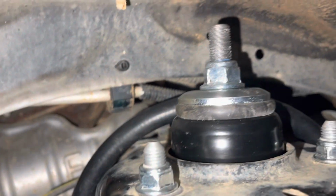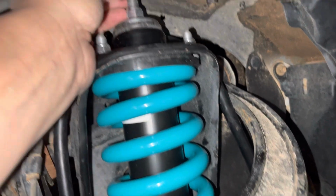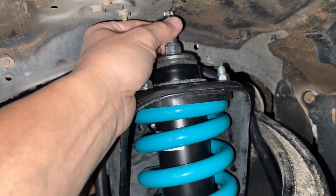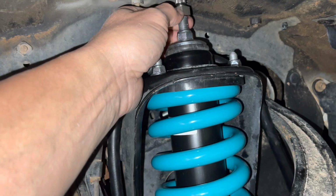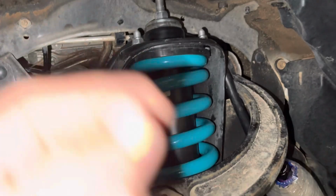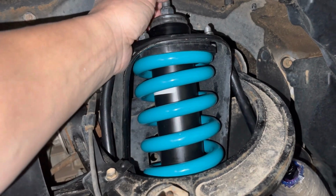you see that little ball bearing and the little spring? So in the very top of the strut is the Rebound Adjustment screw. And we're not going to probably be able to see that because of just how it's in here, but we're going to have just enough room to put the adjustment screw on here. But inside the top of that shaft is a 4mm hex with a little pin. And there's a small hole in the side of the pin, and each time it rotates, it will click. And that's how you count your adjustments for Rebound.